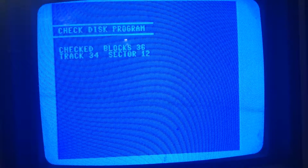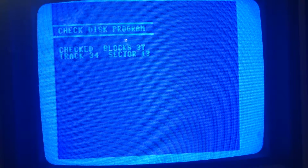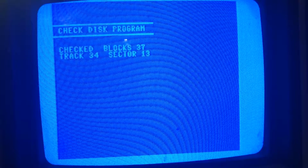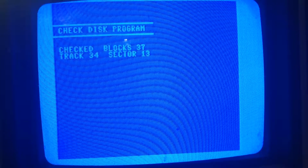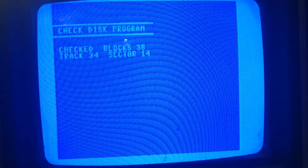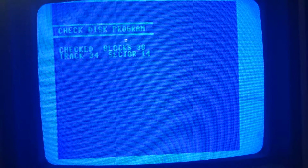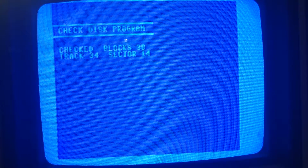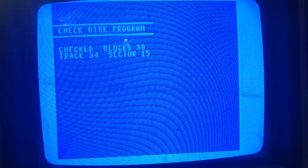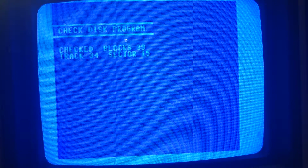Another thing is I look down at this Commodore 64, I see that I have a joystick plugged in. Remember, if you have a joystick plugged in, I think into port number one, it can interfere with the keyboard. Be careful. Don't just immediately think, oh my god, my machine is broken. If something is pushing the fire button or it's to one side or the other, that can affect it. So the things will not type right. So we're now up to 38 blocks. And I think maybe, hopefully, it's almost done. If it's not, then maybe we'll let it sit here and do something else.